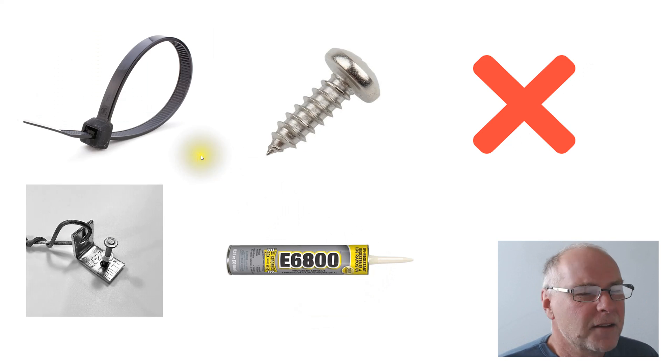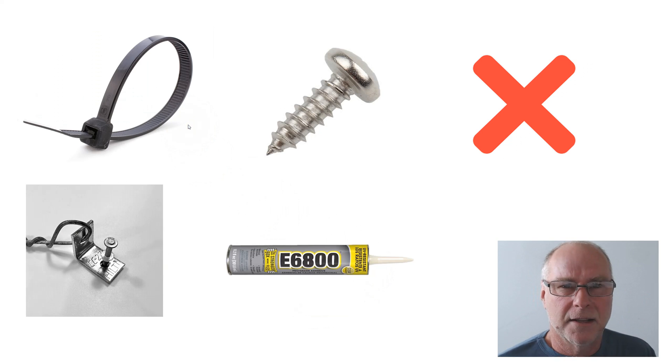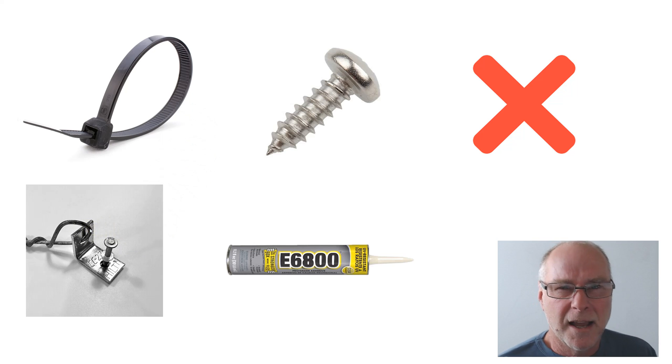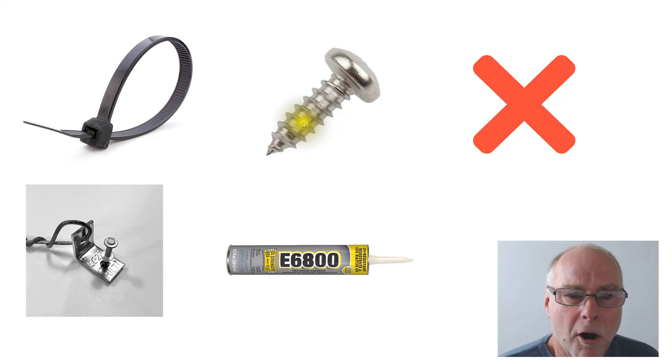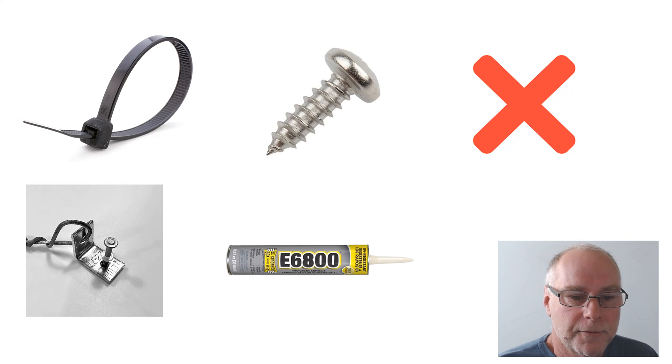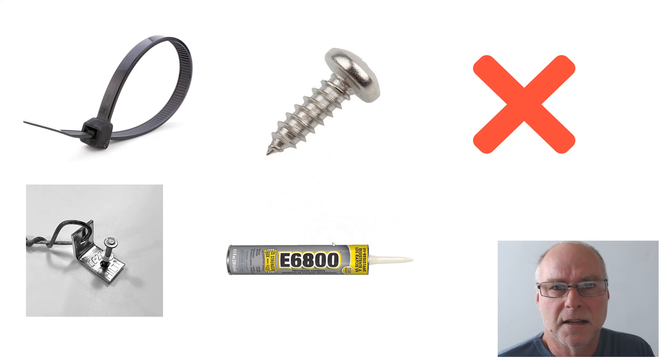Here's what not to use: don't use cable ties to attach an aerodynamic component to your car. Don't use bits of wire. A bit of quality and pride in what you're doing. Don't use self-tapping screws, primarily because each time the under tray has to come off, the hole into which that screw is formed will deform a little more until it's not effective at all. Contrast that with riv nuts, where you can screw in and out a hundred times and it will still work perfectly. And don't glue things into place — when it does have to come off for maintenance you have to destroy the under tray. Really bad way of doing things.